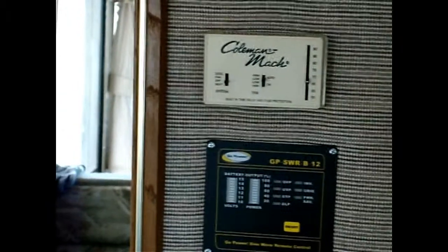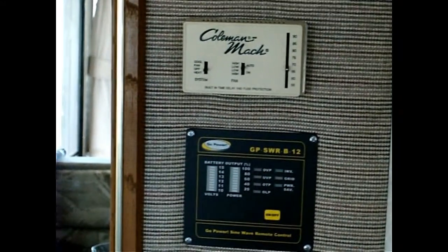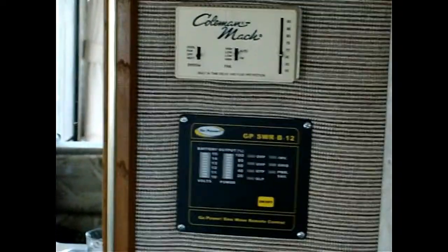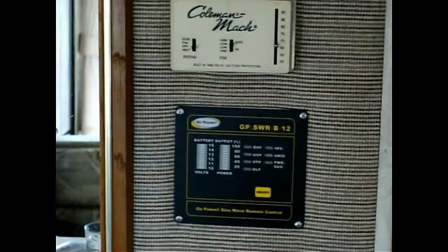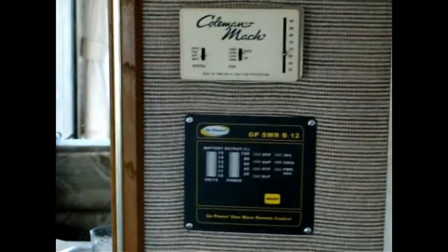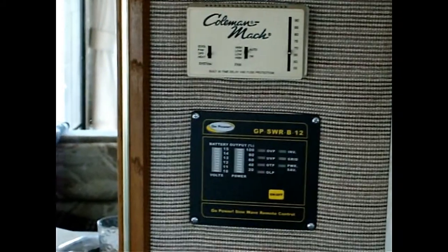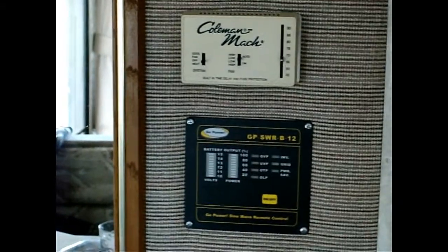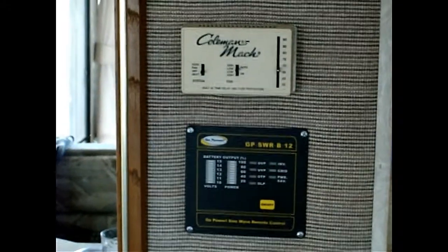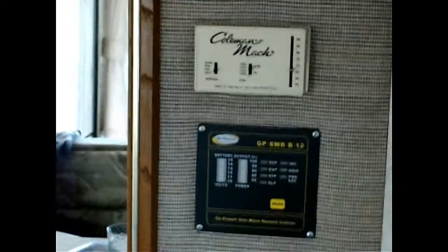Make sure the stairs are clear before you put any 110 power on. You can run the generator when it's like this, but you can't run the generator when you've got the inverter plugged in, even if the inverter is off — so you've got to remember both things. Also, if you turned your battery charger off because you didn't want to charge and draw simultaneously, turn it back on so when the generator comes on or when you have house power, you'll get charging. Other than that, it's been working pretty well. The batteries are brand new, six months old, and I've used half a gallon of distilled water — so watch that water level when you live in it and use those batteries.